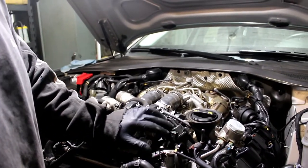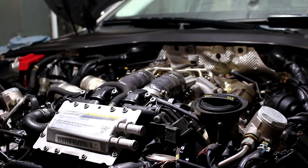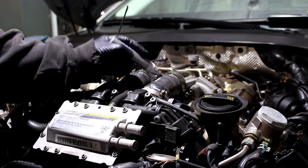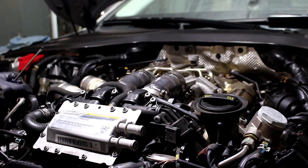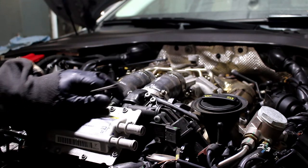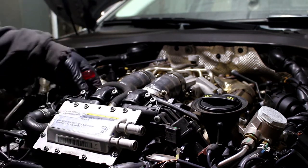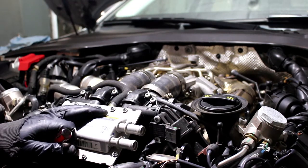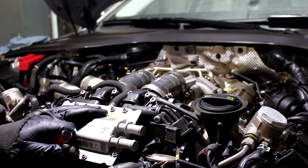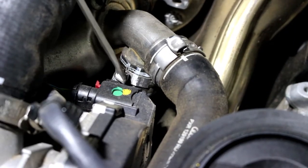I'm assuming we have to remove all this. Here's our throttle body, we have a coolant line, and I just unplugged what looks like the diverter. These look like they're universal and can go on either side, but since this one was on that side, I'm just going to put a mark on it so we know it's got to go back there. I'm going to try to get this coolant line and the diverter system out of the way.